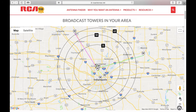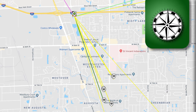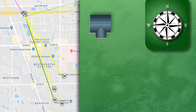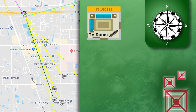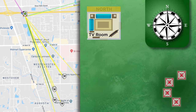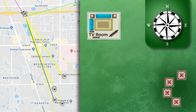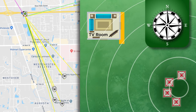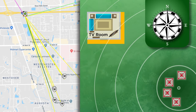The site will show a map with the towers close to your home. The top of this map is always facing north. Once you understand what wall or corner of your TV room faces north, you'll be able to correlate what direction these towers are in relationship. For example, this sample address has most of the towers to the southeast, meaning a window or wall on the south, east, or southeast side of your home will offer the best signal reception.